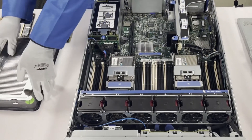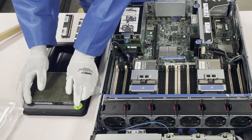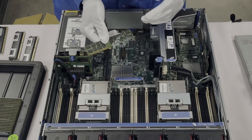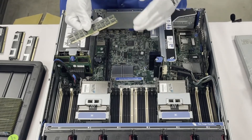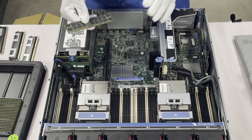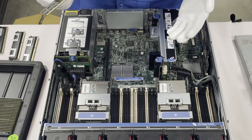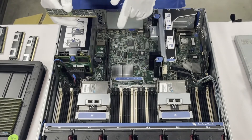For this model, we're loading it up completely with 16 gigs and putting in a second CPU for the customer. Note that the module itself has a notch or key in the middle — this is important because a DDR4, DDR2, or desktop module physically would not fit. Manufacturers have made it this way to prevent user errors. But be careful lining them up, because the notch inside can flip depending on which side the socket is on. Inserting a module incorrectly can damage the leads, the module, or even the socket — making the whole motherboard useless.